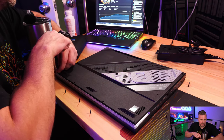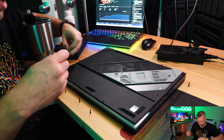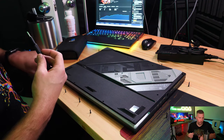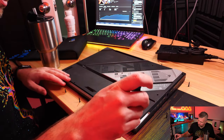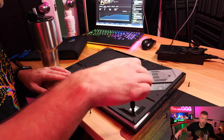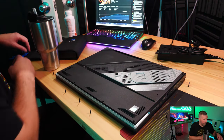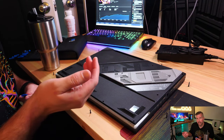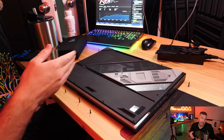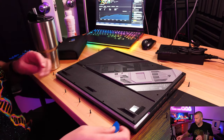Dargan Malcolm asks, did you hear coil whine when you started it or only when gaming? So, I only hear the coil whine when loading up a GPU load, like entering a game, and let's say the temperatures on the CPU and GPU are still low enough that the fans haven't kicked on. The result is you end up with a machine that is under heavy load, but everything else is still quiet. And that's when the coil whine becomes more pronounced.